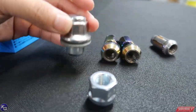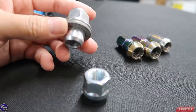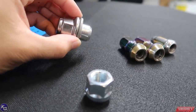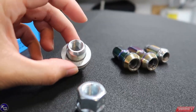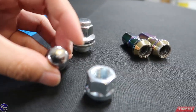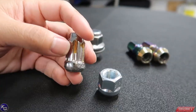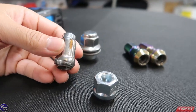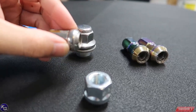I've compiled a bunch of random lug nuts to talk about. This is a factory Toyota/Lexus lug nut — it has a washer piece on the bottom that aligns the wheels, so when you put all five together it guarantees the wheels are perfectly centered. This is an aftermarket generic acorn lug nut — every one of these grooves is the same measurement, very standard. You tighten it and it seats on the wheel and holds it in place.